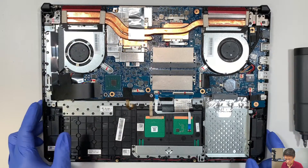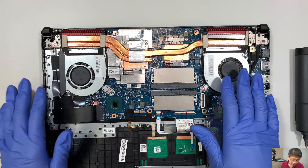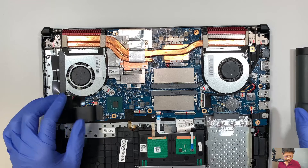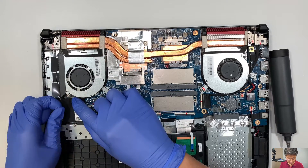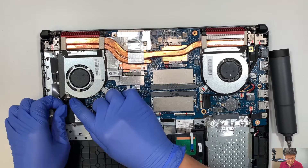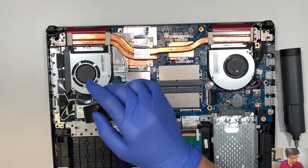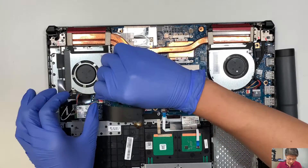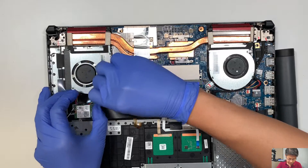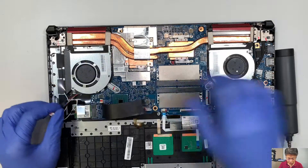Let's move on to the next part. Let's go ahead and remove the fan. Let's explain more details about the fan here. Make sure the tape is not taping things down together. The connector for the fan — just slide it to your left. Once you slide it to your left, that's how you remove it.